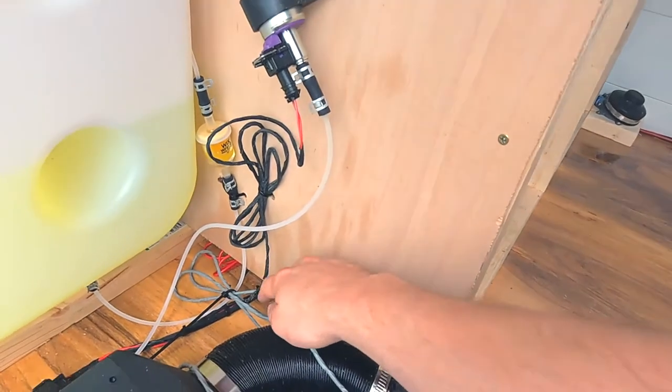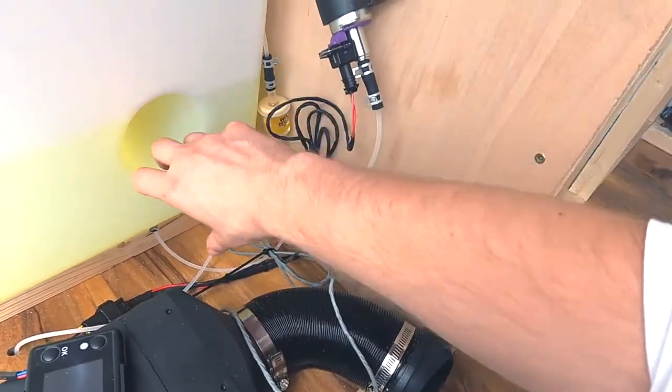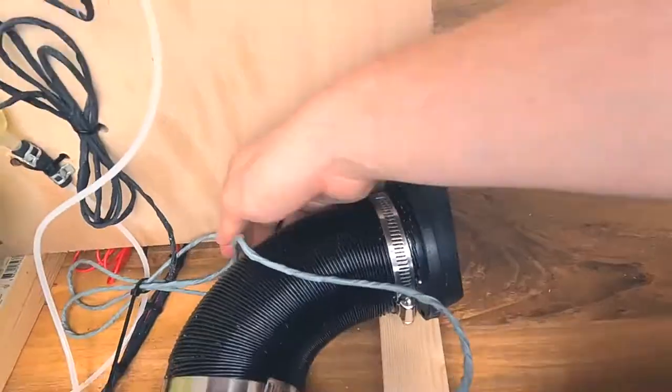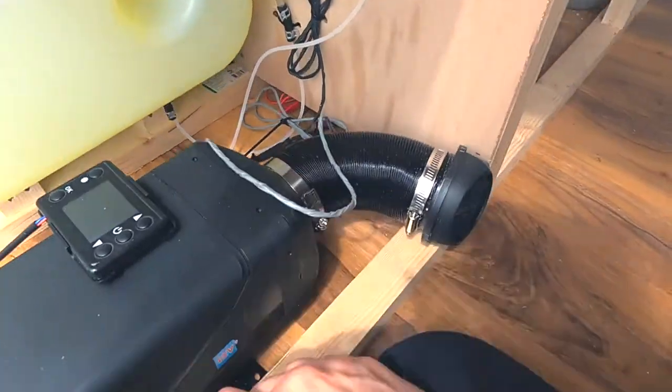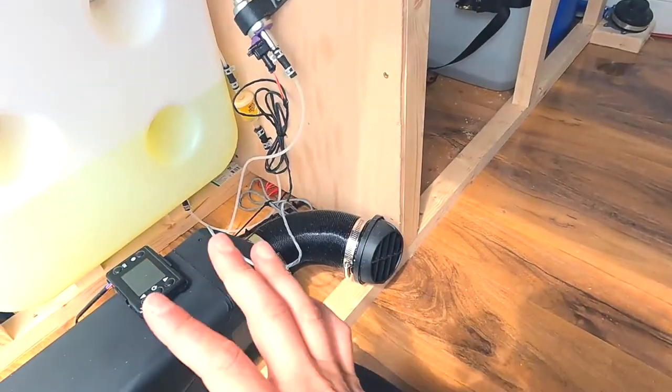While all this was happening, the cables weren't mounted up — they were lying on the floor, so they all got covered in diesel. The sheathing around one cable melted and all the glue reacted with the diesel, turning into an absolute gooey mush. I probably spent an hour or two — it felt like seven hours — slowly peeling all that stuff off, then used electrical tape to cover it up again. I originally thought the reason the heater didn't work was because of that damaged loom, but it turned out the thin power cable was the actual issue. Either way, it does work.